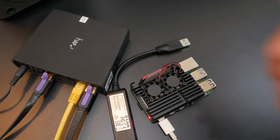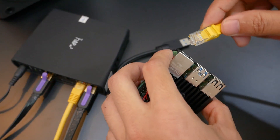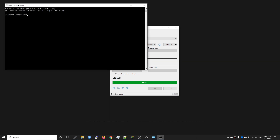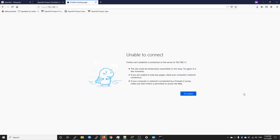After powering up, use an ethernet cable to connect the Raspberry Pi to the computer. On first boot, the LAN interface will have an IP address of 192.168.1.1. Let's check: ping 192.168.1.1 — we have a good response. Let's see if we can access LuCI at 192.168.1.1 — nothing shows up, because we are using the snapshot version and LuCI is not installed by default, so we need to manually install it later.